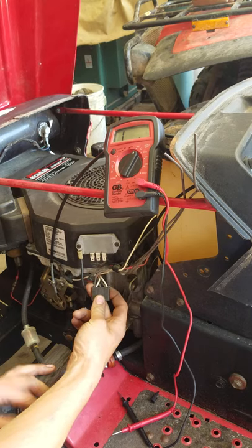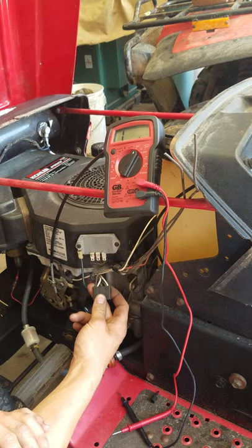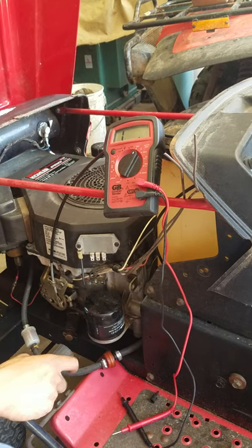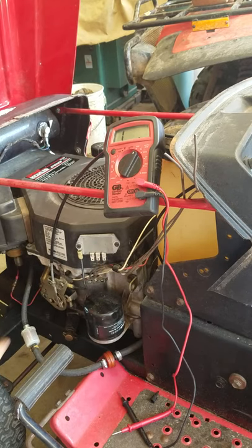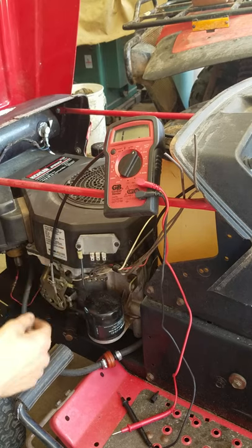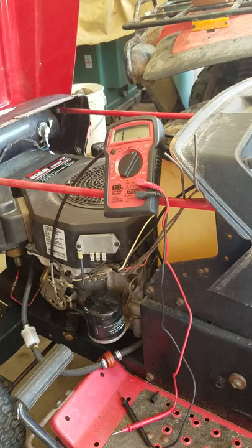The main thing is that you're getting these two white wires going into the two AC inputs to the voltage regulator. It doesn't matter which way they go - it's AC current, oscillating current. So there's no positive or negative until it comes out of the center one, which is positive. And as you can see, you need that ground to be solid; you can't have it wiggly. Although it should also be grounding through these bolts here - I'm sure they just put it in there for extra.